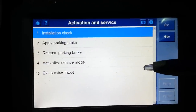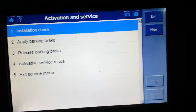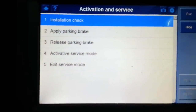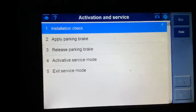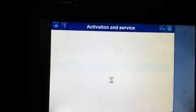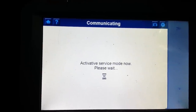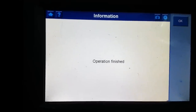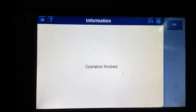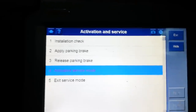What you want to do is activate Service Mode. But first, you have to turn the ignition on, which you do by holding the start button. All the lights on the dash should come up. Click on that. You'll know it's activating because it'll sound like you're activating the Park Brake, except it'll last a lot longer. Click OK, and that's done.